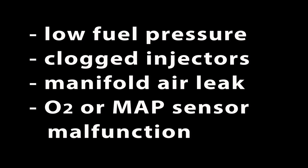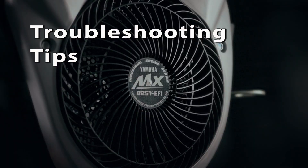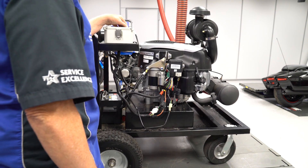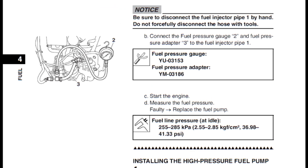This code could be triggered by several reasons: low fuel pressure, clogged injectors, an intake manifold air leak, or a malfunction in the O2 or MAP sensor. P0174 is also commonly triggered as the engine leans out as it runs out of gasoline. Remember, there is no fuel pressure sensor. If the fuel pressure drops for some reason, the air-fuel ratio will go lean and possibly trigger an error code. It's critical that the mechanic verify proper fuel pressure whenever troubleshooting a suspected lean condition or running performance issue.